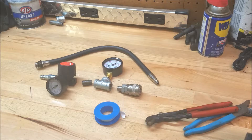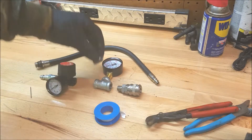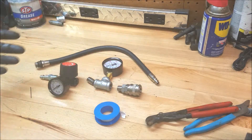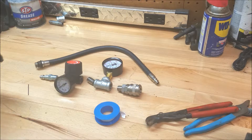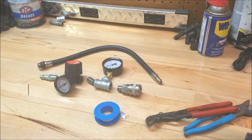A leak down tester is a very simple tool — a pressure regulator and a gauge. It just works off a pressure differential from a partially blocked port. Very cheap to build. You go to Harbor Freight, get your regulator and your gauge. Home Depot sells them as well, they're just a little more expensive — looks surprisingly a lot alike, probably built in the same factory in China. And if you have a compression tester already, it makes this project a lot cheaper. If not, Harbor Freight sells compression testers as well, and it's something you need if you're into working on your cars.